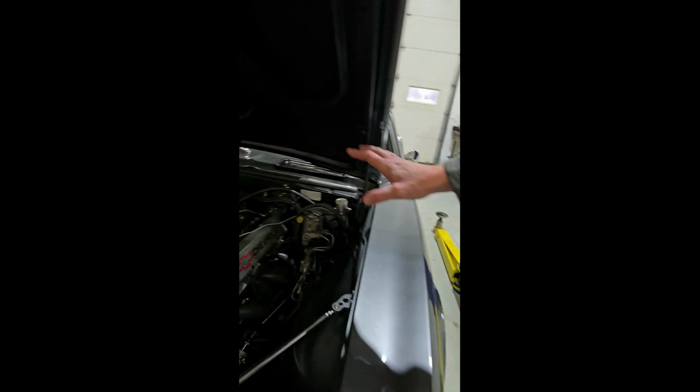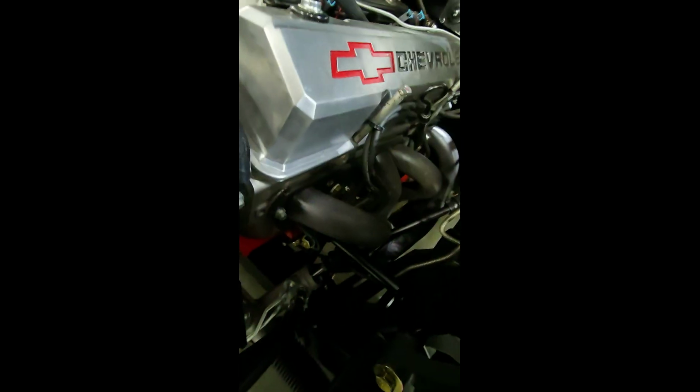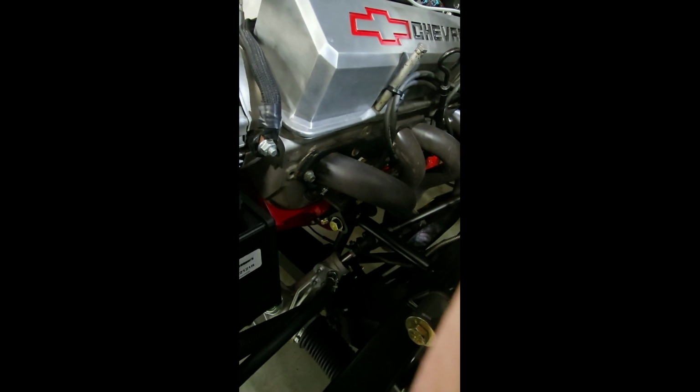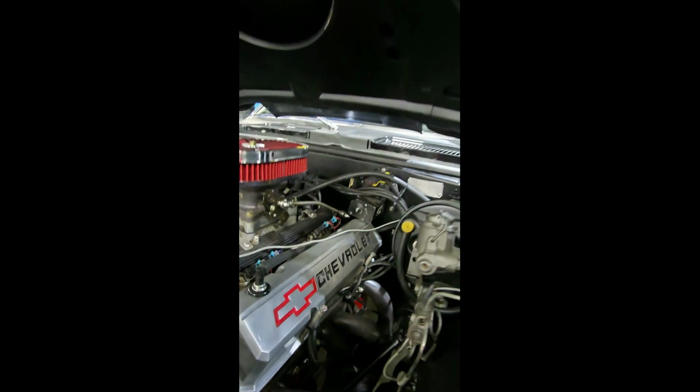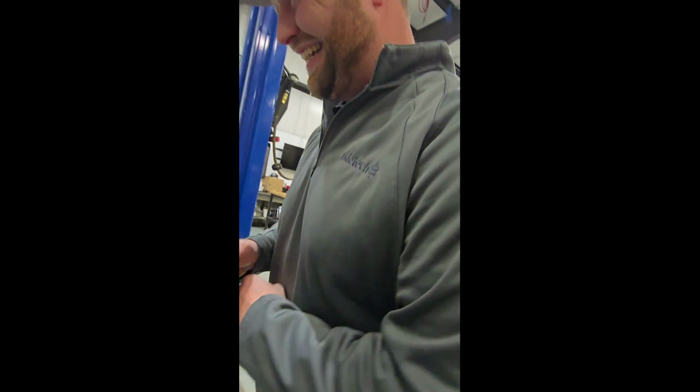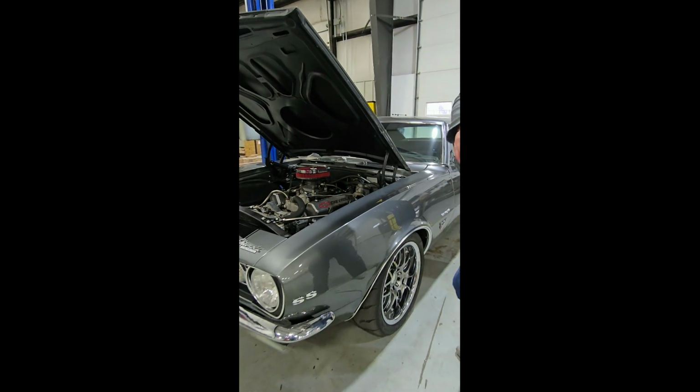Petrie's car is clear by a mile. This is stock small block Chevy locations. My car's LS motor is within 1/8 of an inch of where it used to sit. But yeah, I'm running a 302-3 pan on my car. I could fit my whole hand between the crossmember and the oil pan. That's significant. I have good size hands. Josh is not a small guy. It's clear by a lot.